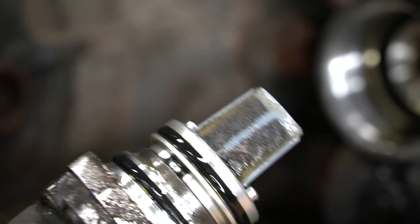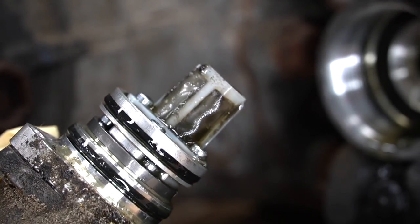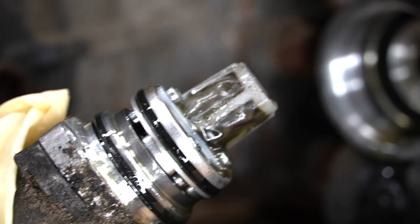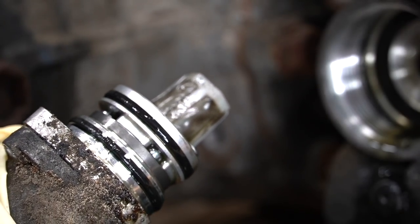What we're going to do is inspect this screen at the end for any kind of metal debris buildup or yuck. If you see that, just go ahead and clean that all out so that when we go back together it's not just partial filtering. We'll set this to the side and clean it right before we go back together. Most of that stuff just wipes right off. If you have a ton of metal trapped in the screen, odds are you might have a more severe Haldex issue and you'll probably want to get that taken care of.